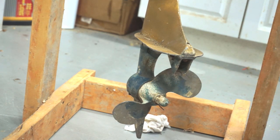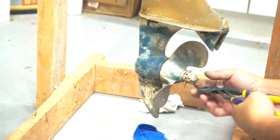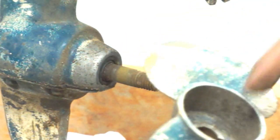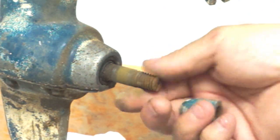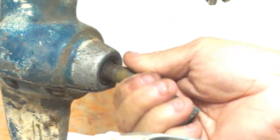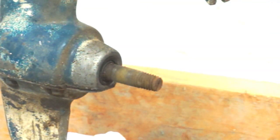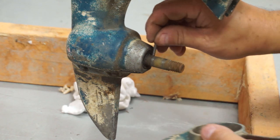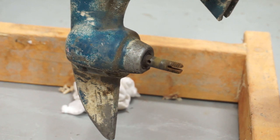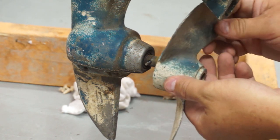Let's take the prop off and just look at what's behind there. We'll take the cotter pin off first. The shear pin is completely missing here — so we've got one for our Evinrude that we'll stick in there. That seal doesn't look too bad unless it's empty. Let's get that shear pin put in and then fill the lower end up with some oil. We've got our shear pin, so we'll attach that through here. Let's turn it sideways so it won't fall out — I'm just rotating the shaft up top so we can turn it sideways. We just attach our prop in the same fashion.